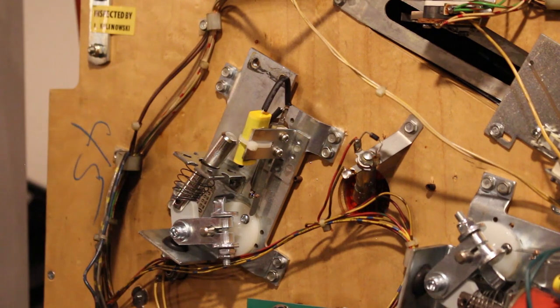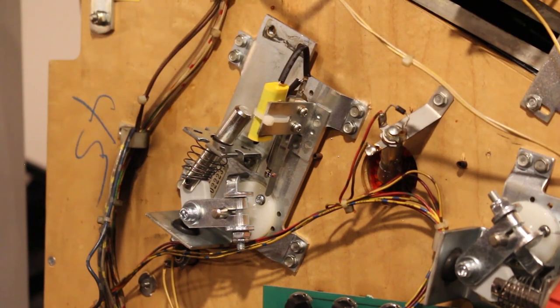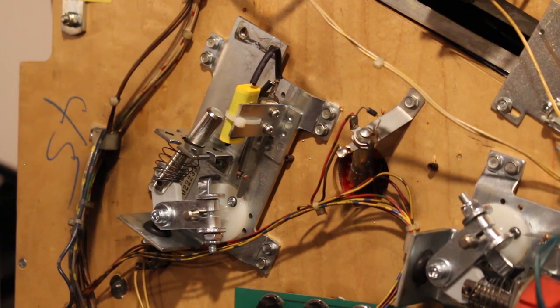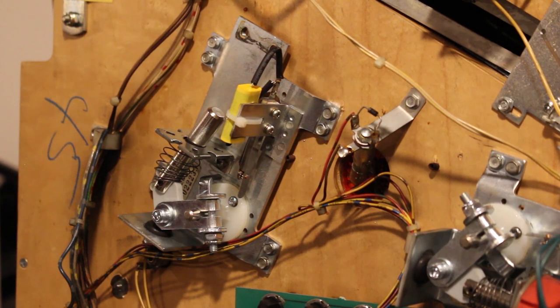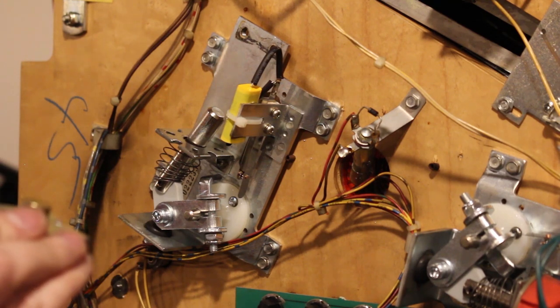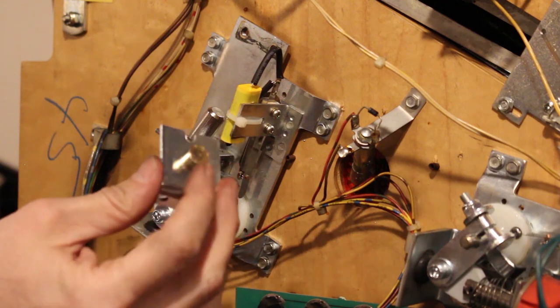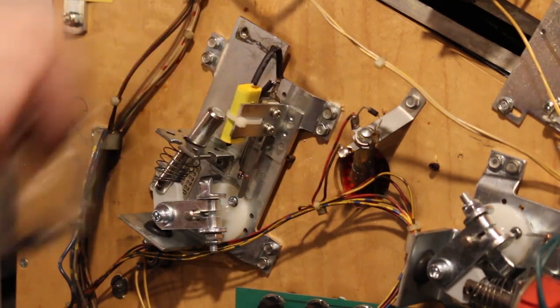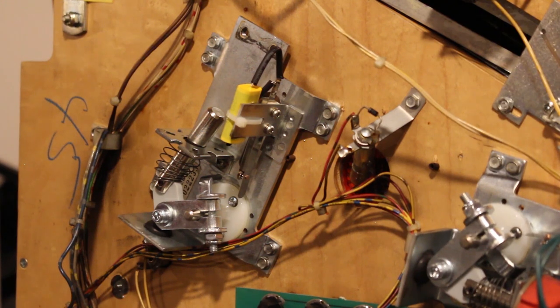Let me get a new battery — that always happens to me. From the bag of parts, we need the sleeve and a new coil stop. The coil stop has a shiny little cylinder part — that is the edge that goes into the coil, and that sometimes gets mushroomed out from getting banged around. The kit does come with new screws with lock washers. We also have a grayish-tan plastic sleeve for the solenoid, and we'll put that in as well.